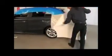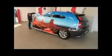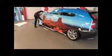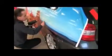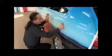The width of vinyl is then folded over, working from the left side to the right, and a further third of the silicone paper is pulled away and cut off. The vinyl width is then, carefully and with slight tension, laid across the vehicle and evenly pressed into place with the squeegee at curved and rounded places, as described for the preceding steps. Preheating the vinyl in large sections at 50 to 60 degrees C and generous squeegee movements are necessary to avoid tensions inside the vinyl.